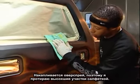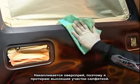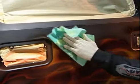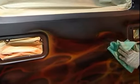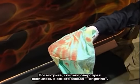Okay, the overspray is building up. What I want to do now is, in the areas that are dry, take your tack rag and lightly dust over it just to knock off the overspray. Because if you don't knock off the overspray, you can easily get lost as to where your fades are, like from your orange to your yellow. And you want to get a good, nice, clean, even fade. That's a good indication of how much overspray you can get off of just one pass.